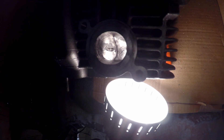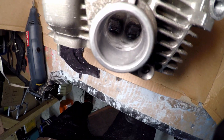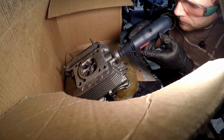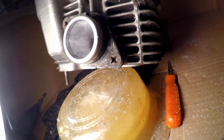It's not too shabby now — you can see it's all shiny. I've removed a bit of material off around the pockets. This is the piece that bolts onto the cylinder head. Now I'm going to clean up the transition between the two, because they're both cast pieces but they haven't been matched. There's no transition at all — it's completely abrupt. The finish isn't actually too bad, so I will now clean this up.